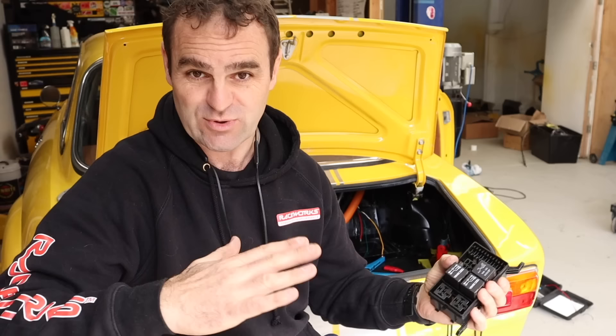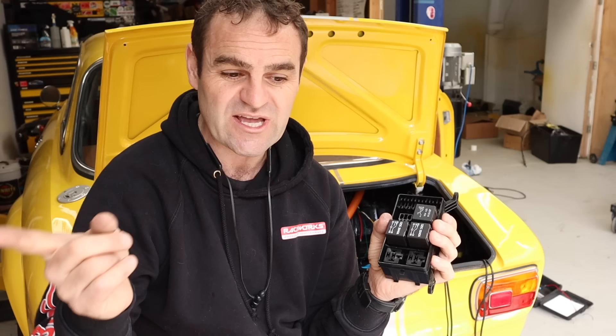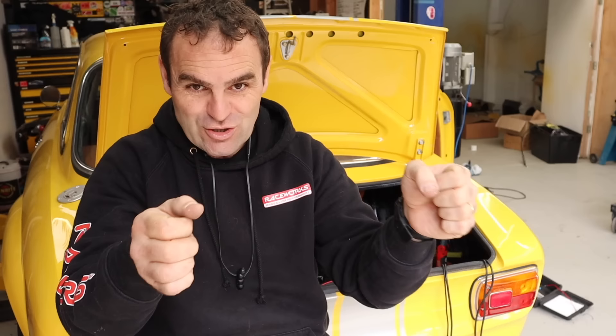These other two relays are going to be for the exhaust valve. I built this car with a switchable exhaust. I need one relay to open the exhaust and another to close it, and I'm going to use the same method as electric window switches. It took me a while to grasp how an electric window switch works, because you basically have two wires going into an electric motor — one positive, one negative — but to make it go the other way you need to switch that around. In the off position, it's connecting negative through to both sides of the motor so nothing happens. As soon as you press the switch in one direction, it connects the positive — so one side of the motor gets positive, the other already has negative because it's not being touched. That's how they work — and that's the same with the exhaust valve.